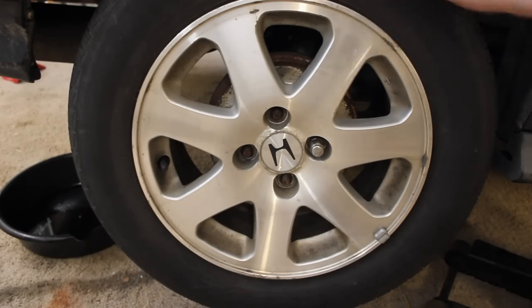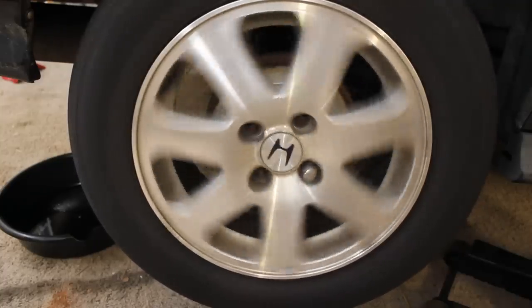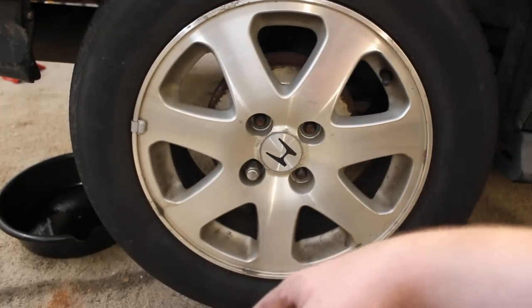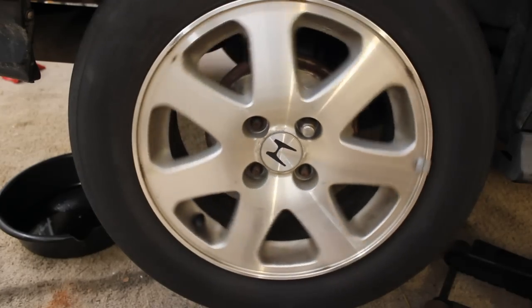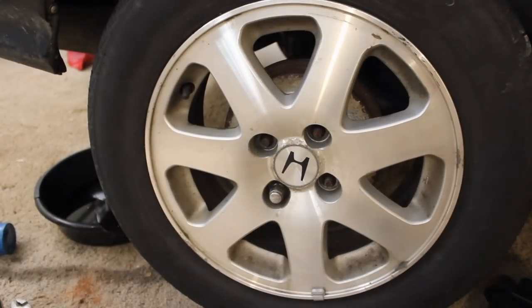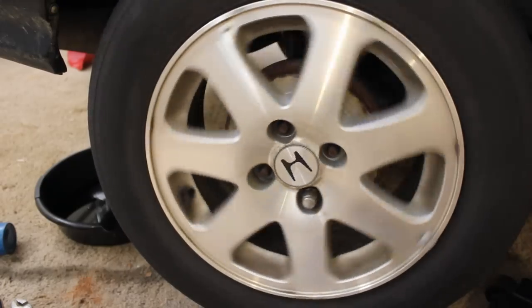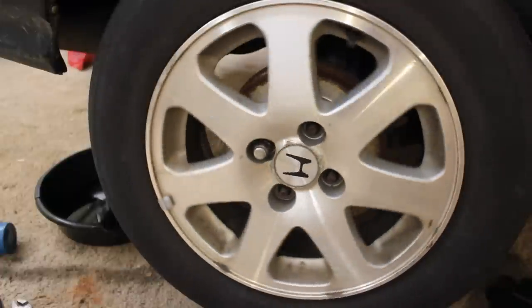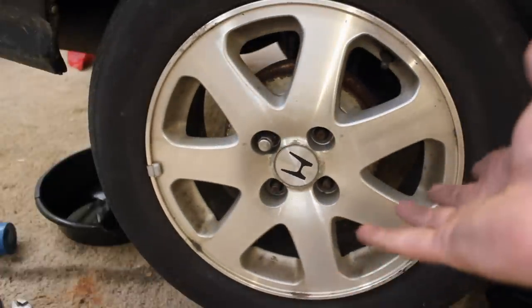Okay guys, this is my first attempt to tighten up the drum brakes — and as you can see, I spin it and it just keeps on going. So that is not tight enough. You can see that lug nut made more than one complete circle, so it needs to be tighter than that. I'm going to give it a few more tries. Now I've adjusted it again, and as you can see, I spin it one time and it kind of stops. If I were to spin it a little bit harder it would keep going, so it could probably stand to be adjusted a little bit more. But as you can tell, it's tighter than it was — just make sure it looks a little something like that.